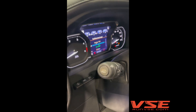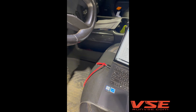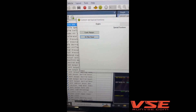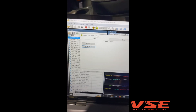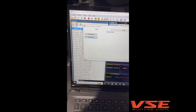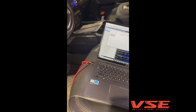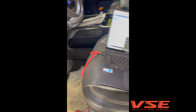The previous model year trucks — 2017 to 2019 — did not have that in them, so you didn't have to clear those messages. Anyway, I hope this helps. That button is right in the HP Tuners software now. If you just want to get the annoying message off your dash after ECM replacement, hit that button and it takes care of it. If you're doing the immobilizer relearn via the GM MDI tool or a Mongoose tool, we'd recommend doing the immobilizer relearn and then the air filter reset at that time. This was a lot of work and we'll continue to get more cool tools in there to alleviate some of the pain points about swapping ECMs in these trucks. Thanks.